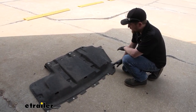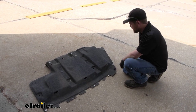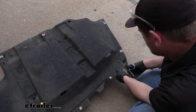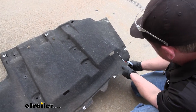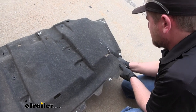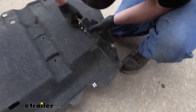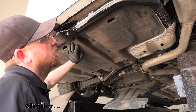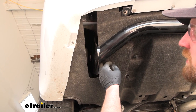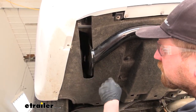With our hitch in place, we can come back to our underbody panel and trim it out. There's a diagram in the instructions that tells you where to cut. This is almost like a thick cardboard, so you could probably use a regular pair of scissors to get it done, or a pair of snips — whatever works best for you. We'll go ahead and get this material removed, then simply re-secure it the opposite way that we removed it. One thing I do want to mention is I did have to cut out just a little bit more material on this side, close to the center of our vehicle, just to get it to clear — not really a big deal, just something I wanted to point out.